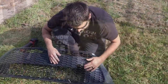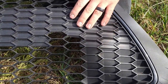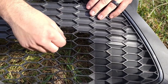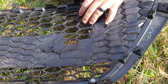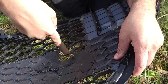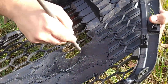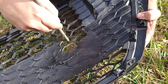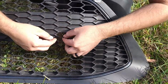We've got these pieces open, and as you can see there's a little bit of debris left behind. There are a couple of ways to do this — what I find to be the easiest is using a Dremel with a sanding drum or a light abrasive, and then just coming in from the backside and cleaning all that up. Some people don't have access to that, so that's where you can get nitty-gritty with a hand file and go through and remove any of that material. This is one of those areas that's going to take a little patience, but it's not too bad. As you can see, we're really starting to open that up and make it nice and clean in there.